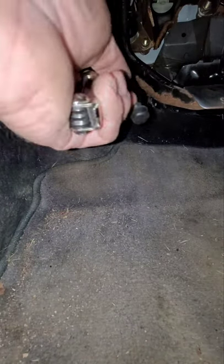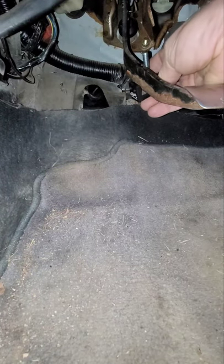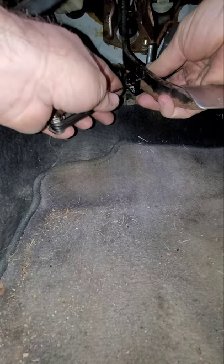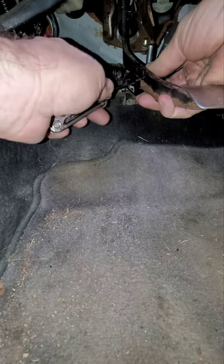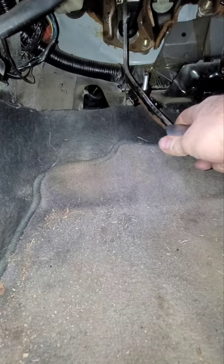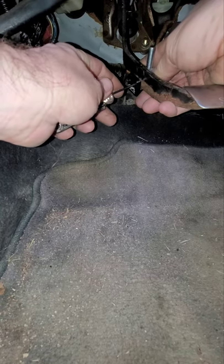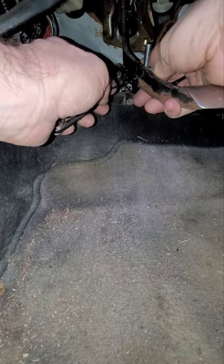The installation is very simple. Simply slide it up on the notch on the clutch pedal. I usually take the first screw and just barely snug it up, make sure it's where you want it because it needs to come in contact with a solid piece of the floor pan. If you want to adjust it, just loosen it up and slide it into the position you want.